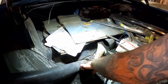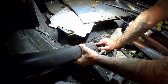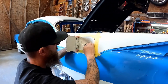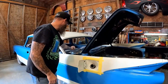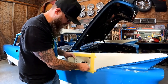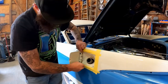We've got everything out of the way finally. Let's get this carpet — you see this tube has to fit inside this hole. There we go — look at that, it just fell in like butter once we got everything out of the way. Jumping over to the outside, this is where things get really tricky. Getting it down in there without messing anything up — and there it went. What a pain. Finally we're in. Now trying to get the bolts on it because that is all that holds this in — these four little bolts. Get those on, get them tightened up, and then there'll be a rubber grommet piece that goes around that to keep it from flopping around in the hole.